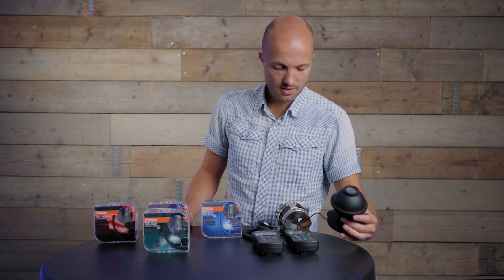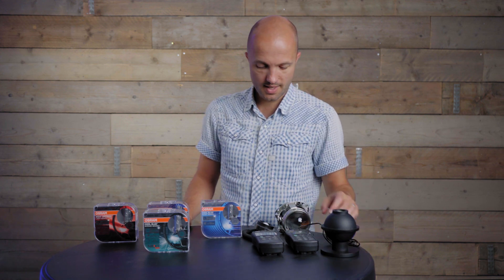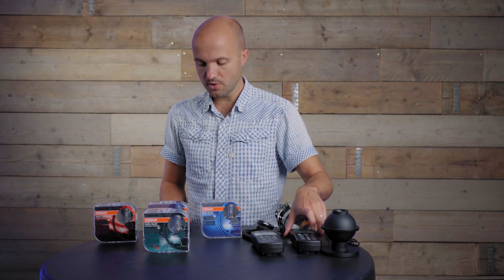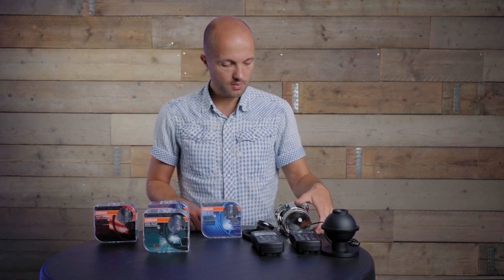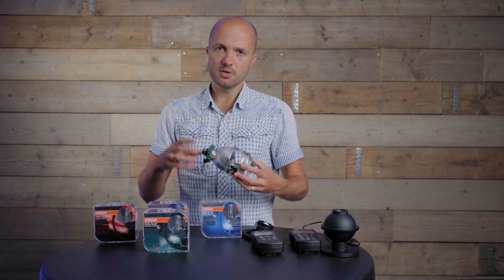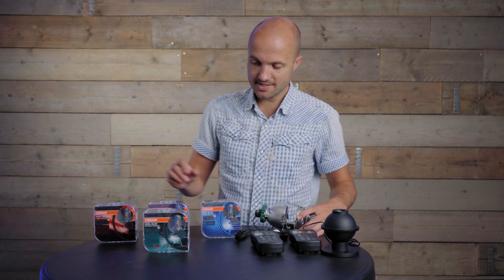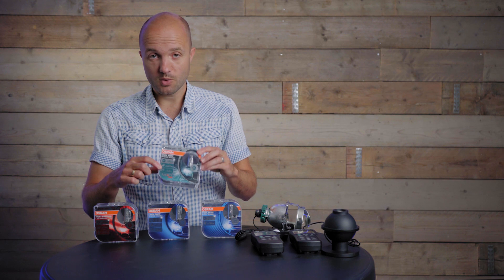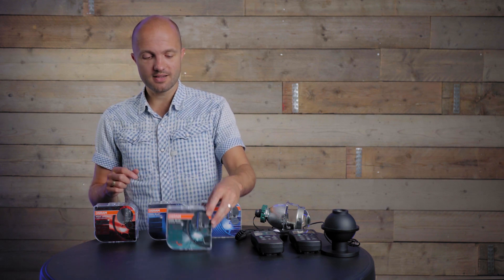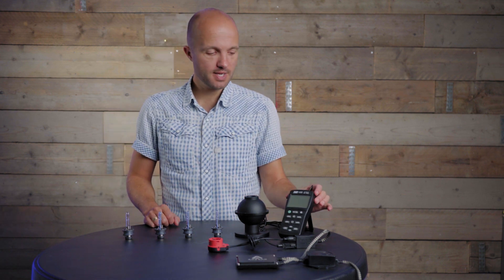So this is how we're going to test it. We're going to test it in this luminous flux meter and measure the total light output compared to the other bulbs. We're also going to compare it in a projector — the EVO XR 2.0 — where we'll use a light meter to see what the differences are and whether it's really plus 150% as the package claims.